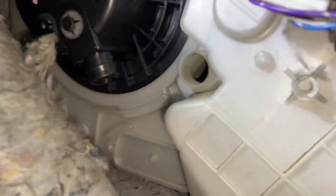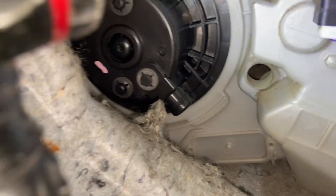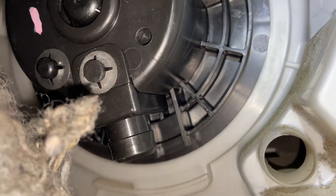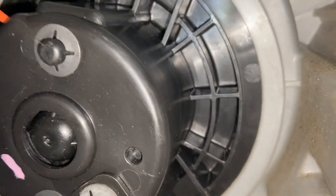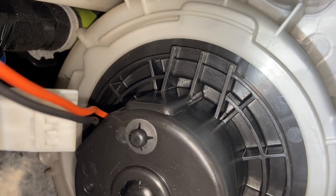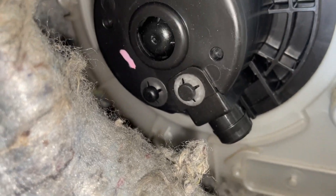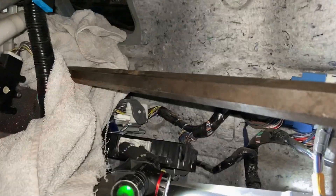I think I've got the motor in position. The vent tube should face down. Now I need to get one of the kids in here to hold it from the back side. I'm going to have to put that lock ring on somehow. I stuffed a towel in there on the back side of the blower motor and stuck a big pry bar in here. Maybe I'll put something on this end and close the door to give it a little bit extra.